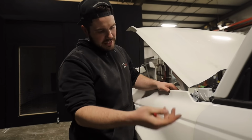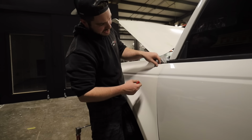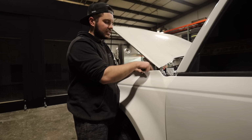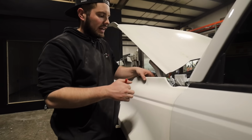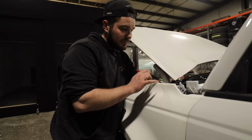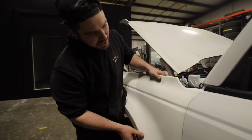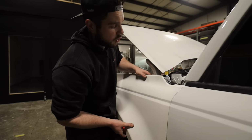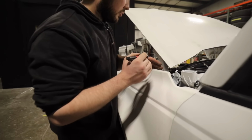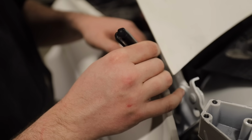Okay, so before we took this fender off, again, checking, right here you can see that everything lines up here, but this top up here is never going to get out this far to meet. So right here, I made a little mark on this 7mm back here on this part of the fender. I need to oval this hole out a little more, to give me more outward adjustment. We've got plenty of room to spare, but if I just give me a little bit more, this can center up and I can pull it in with the middle bolt that's hiding behind the fender here. However, I'm never gonna have a flush surface here with how I drilled this hole before, so I just need to modify it a little bit and it'll give me more adjustment and we'll be good to go. So all I did was mark an arrow there. We'll be able to bring this hole a little bit more that way, just a little reminder.